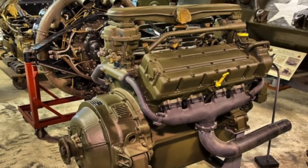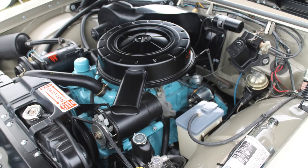Be sure to check out one of the videos on my channel for more detail about that engine. One of the more famous engines to employ this technique was the Pontiac Trophy 4, introduced in the 1961 Tempest. The Trophy 4 was quite literally half of a 389-cubic-inch V8 — literally a 389 V8 with the driver's side cylinders missing, just the passenger cylinder bank. It displaced about 194.5 cubic inches.